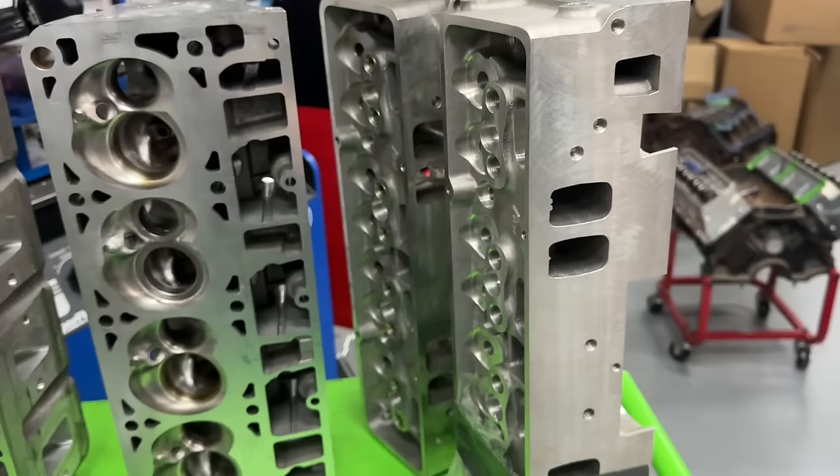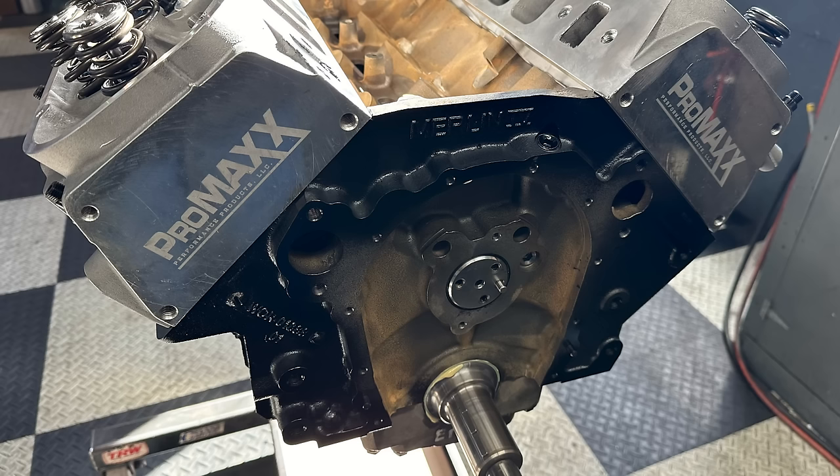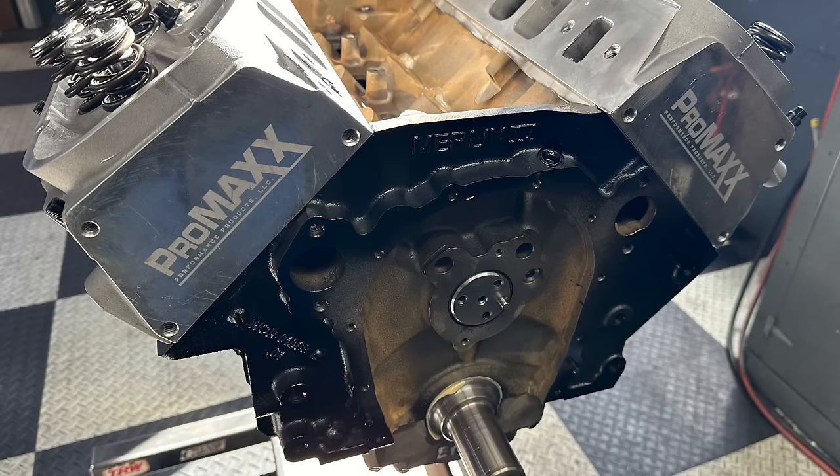Now let's talk about the 540. This is the 540. Look how close it is to being done. Gary Dunsworth at Dunsworth Machine Shop sent me this photo. It's getting close. I would say probably in February the dyno stuff will happen for the 540. He obviously has to check piston and valve clearance. He just got the heads sitting on there. Before someone says, oh my God, look at the rust, the block was cleaned.